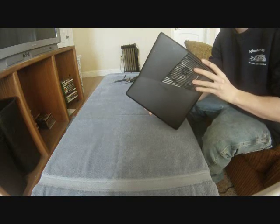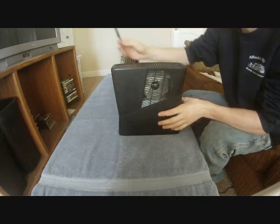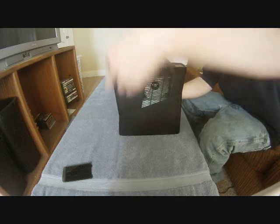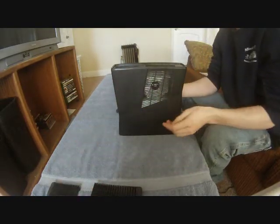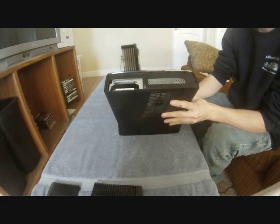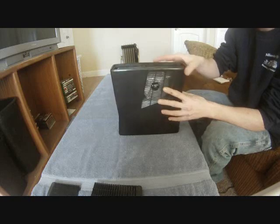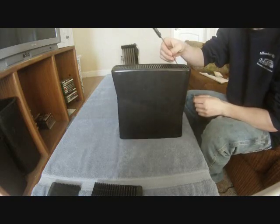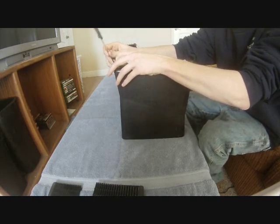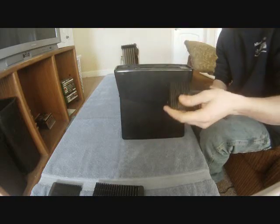All you want to do first of all is remove the hard drive side. If you don't have fingernails like me, you need a knife or a screwdriver. Just pop this up like that and grab the other side and gently pull — that side comes off. As you can see, your hard drive is exposed right here. I have a 250GB original Xbox 360 hard drive in there, because you can disassemble your old hard drive and put it in your new slim. Flip it over, do the same thing — put a knife in here and just gently pry up on this to get it started, then pull back like that.